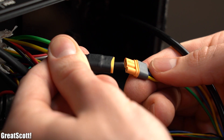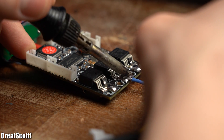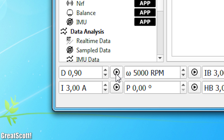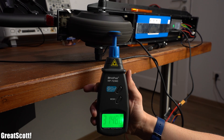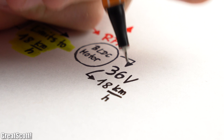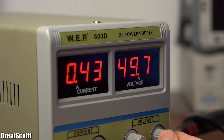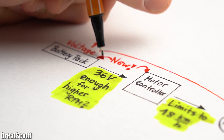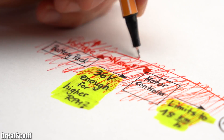Next I disconnected the motor wires as well as the power wires of the battery and instead hooked them up to a VESC. After configuring the motor through the VESC software and telling the VESC to spin the motor as fast as possible with the power of the battery pack, I measured an RPM of around 3200 as well. That was quite a surprise, because that means the motor is specifically designed to achieve 18 km/h with the given voltage of the battery pack, and only increasing the supply voltage would lead to a higher speed above 18 km/h. Since getting a higher voltage battery pack and using a new motor controller would be quite a hassle, I decided to not alter the maximum speed.